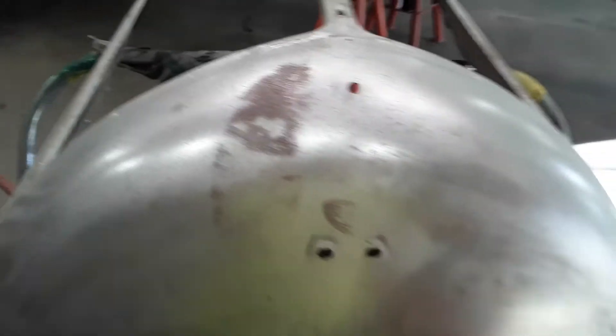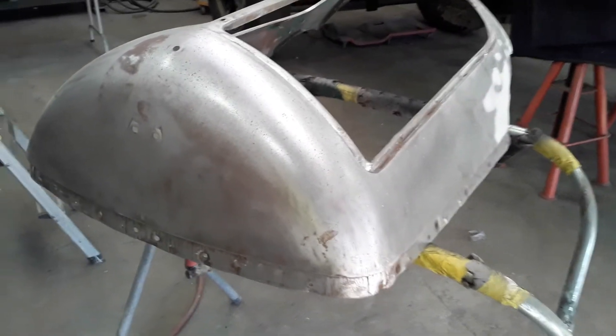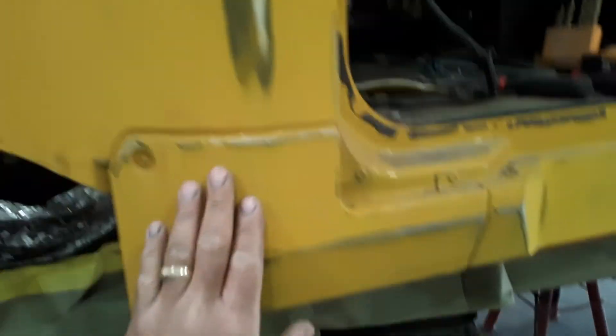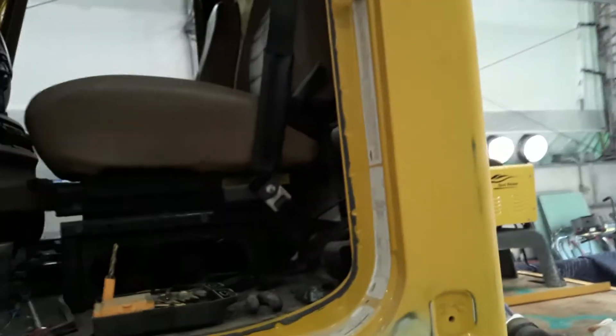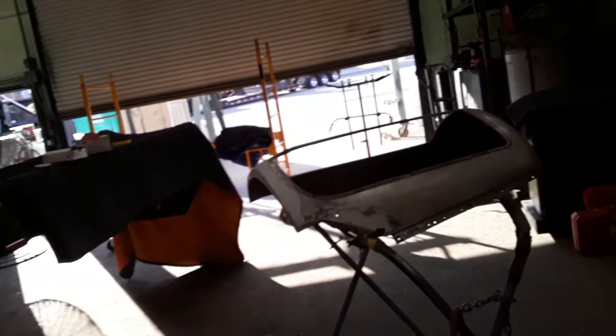Other than that, this is coming out awesome. It's gonna be green. I still gotta sand with 180 all around it to prepare for epoxy primer, so that's the project for today — Saturday morning. I also fixed this section right over here. I'm still going over it with 320 all around, pulling that dent up there, and after that hopefully I can start spraying on Thursday before the holidays.